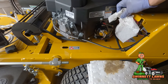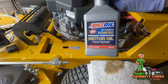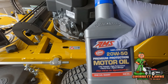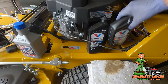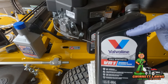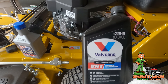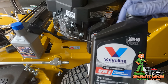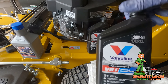At this point I'm going to go ahead and put two quarts of oil in here. Normally I use the Amsoil 20-50, but I'm going to show you what I'm putting in this mower next. This Amsoil is the oil I normally use and also in the hydros — it's phenomenal, 100% synthetic, a Group 4 base stock, actually made in the lab. I tested different oils in my other trim mower — I used the Valvoline VR1 racing oil in the silver bottle; it's a little cheaper and it's conventional, not even synthetic. To my surprise, the oil analysis came out as good as running the Amsoil. So this is the full synthetic oil I'm going to be trying — I've already got it in my other mower and I will do an oil analysis and a video comparing all three different oils.